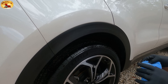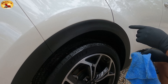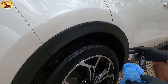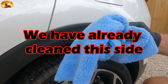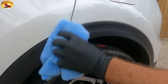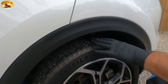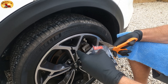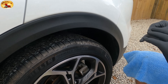Let's go over to the other side and I'll show you how to apply this trim sealer. All you have to do is do what I'm doing. Let it dry for 8 to 12 hours out of the rain. If your stuff is really faded, you may have to do a second application, but in this condition we'll only have to do it once and we'll never have to do it again. We're going to use the product and then use a clean microfiber — once you apply it, put the microfiber to it and dry it lightly and you're done. This product is guaranteed; you'll never have to mess with your trim again. The packet has a rip top, but I find it's easier to just cut the top off.